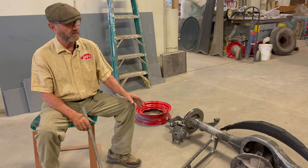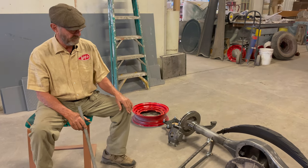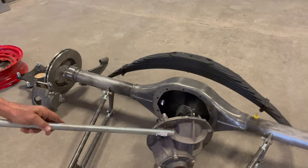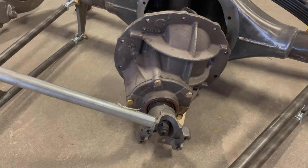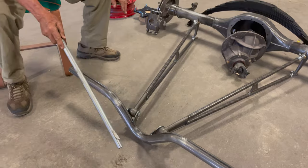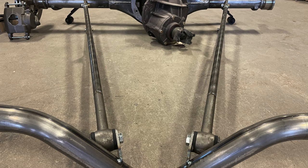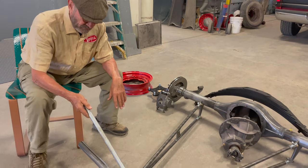Mark Richler, our chassis builder, has probably built hundreds of chassis and he designed this system for us. He's removing some of the stock stuff that gets in the way. We have the rear end housing, which houses the third member. On the front of the rear end there's a shackle that attaches to the drive shaft. There's also a loop — if a bearing gives up, the drive shaft simply drops into this loop so the car isn't completely upset. That's a critical safety measure.